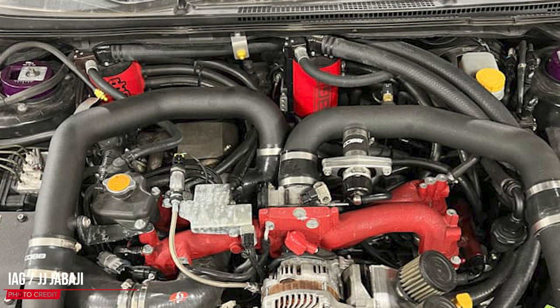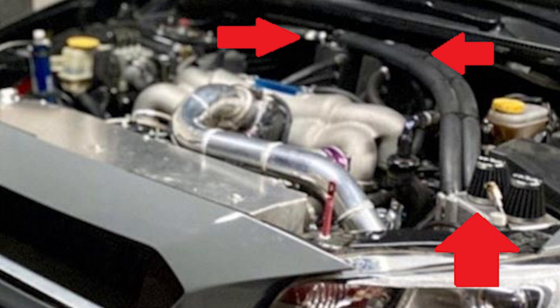This is similar to people running multiple air oil separators. For much higher power applications, one of the first things we've seen is running two air oil separators — so instead of a single one-inch vent, maybe you have two AOS units each with one-inch vents, giving you two one-inch vents. In a motorsports application, you might have both of those vents feed into a large catch can for the same reason: if anything comes out, it's caught and not spread on the track. It is possible with an air oil separator to run into a circumstance where oil comes out the vent tube, so having the AOS in place doesn't absolutely guarantee every bit of oil is captured and returned to the sump. Sometimes, through different circumstances, you might have something coming out the vent, and that's where you'd want a catch can in place.